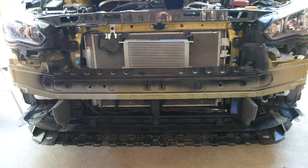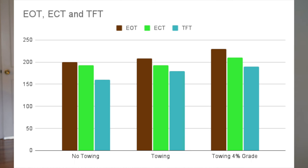This thermostat is a good addition, but long term I'd really like to replace that heat exchanger up front with a smaller one — the Mishimoto WRX CVT cooler is massive, takes up a lot of space, and blocks a lot of airflow to the radiator. It's just plain overkill for the applications I'm using this car for, which namely is light duty towing and camping duties. I want to put a smaller auxiliary CVT fluid cooler up front and also pair that with a small oil cooler, which is kind of a missing piece to the puzzle — during my towing adventure, I noticed the oil temperature was kind of an outlier. But all that can wait. The car is in a good place for handling the cooler temperatures, and I'm really happy with how this all turned out. Thanks for watching, be good to each other, and we'll see you down the road.